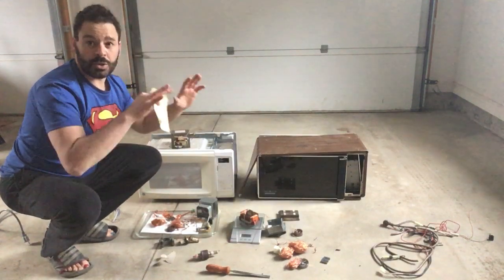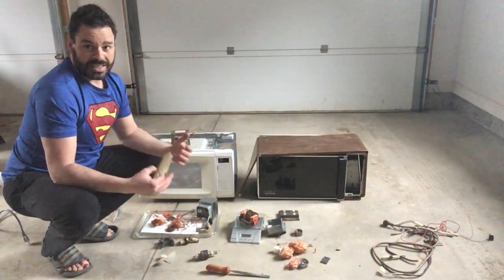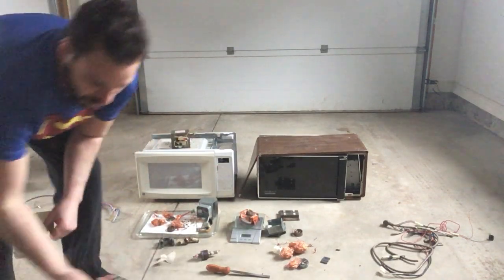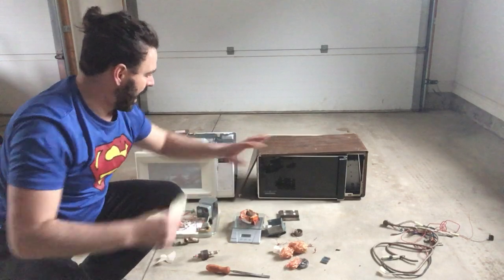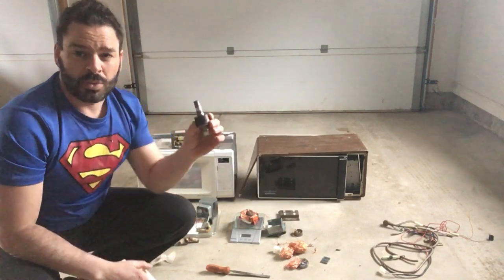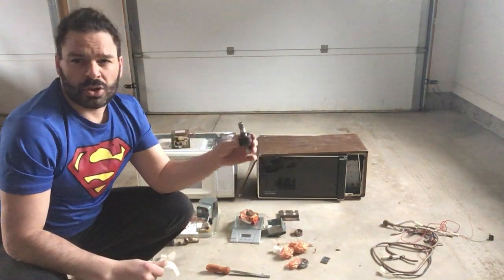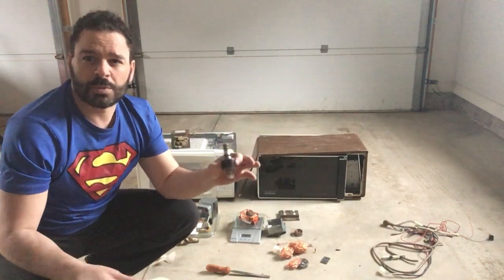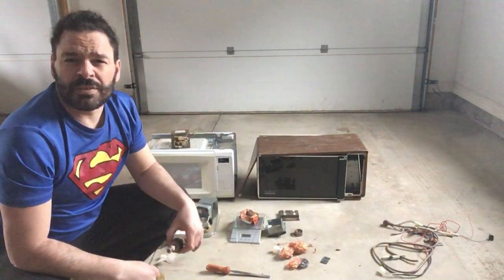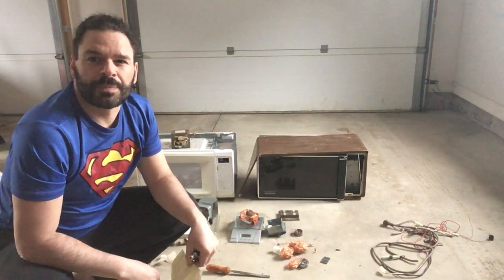So as you can see, yes — there is significantly more copper recovery in older microwave models. Are they more dangerous? They are equally dangerous from the capacitor charge. However, as you get into older models there is a greater likelihood the ceramic strips carry beryllium. I treat all of them with the same safety cautions, because your health is not worth ten dollars worth of scrap. Hope you enjoyed the video — please comment, like, share, and subscribe. Tin Man out.